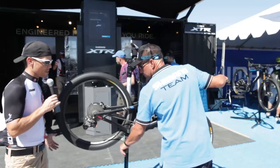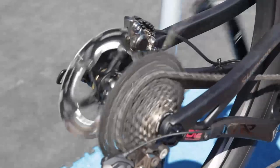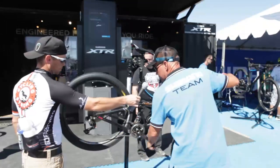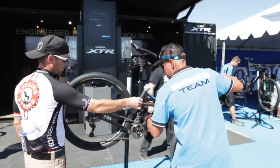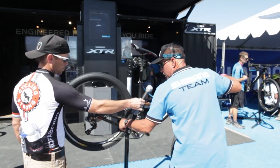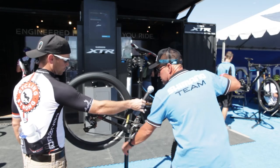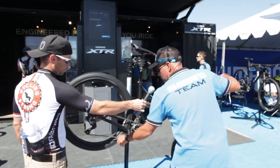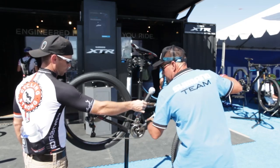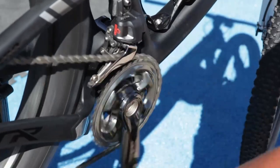He's running everything with his thumb and one shifter. We're going inward shifting now, coming up. Holding the button down, we're shifting — front derailleur shift. I'm going to show you that slower. Coming down: four, five — there goes your front derailleur shift right there. The front derailleur automatically trims as you keep coming down to a taller gear, shifting away. Basically, in synchro mode we have 13 sequential shifts. Watch the front — you didn't hear it, but it chimes telling you the next shift will be the front derailleur.